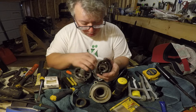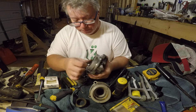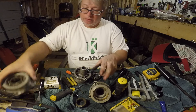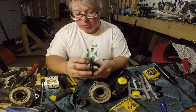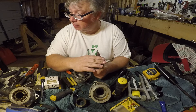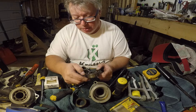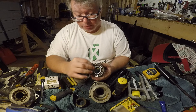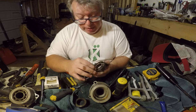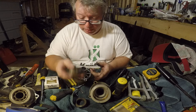However, this top bearing is going to see the most heat because heat rises. You are going to want to get that bearing in, and the other part about this bearing is when you put it back in it should go in pretty smooth. However, you need to get something as wide as that lip in order to push it in. I may cut out a piece of wood in exactly that dimension and use the wood to tap it in, because it will be soft and it won't damage your bearing when you are putting it in.